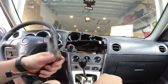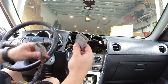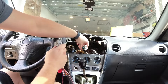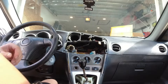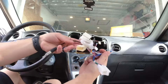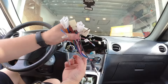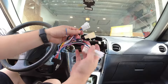Here's the plug. For 2003 and I believe 2004, you're going to want to make sure you get the correct plug. This right here is a GM connector, so Toyota connectors are slightly different. We're going to take this and splice it into the harness supplied. If you had a 2005 and up Matrix, you would use the Toyota harness because it has all these plugs, but GM puts it into one plug so you don't have to have multiple plugs.